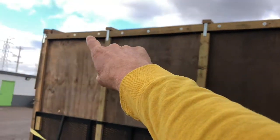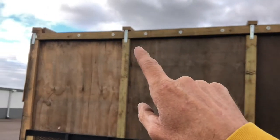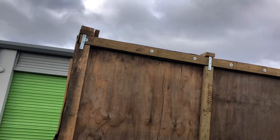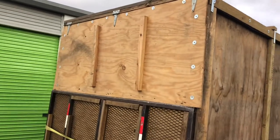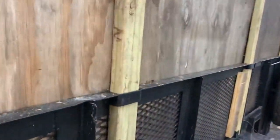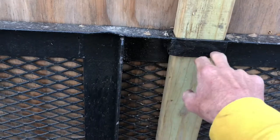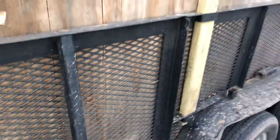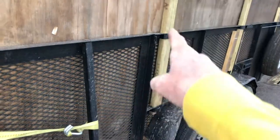This 2x4 here — on the other side it's wrapped around the mesh tarp one time, just wrapped and tucked down once, screw that in. And then those bolts across the top hold the walls from pushing out too hard. I did this myself — took a while. I chopped this angle iron open and basically welded a stake pocket in here so that this 2x4 can go down and be flush up against this plywood, and the plywood can be flush up against this. If you start thinking about how to get the walls up inside there, you'll see what I'm talking about.